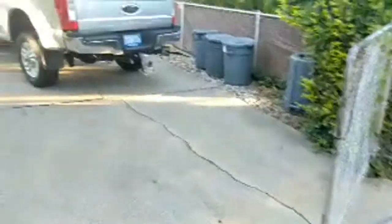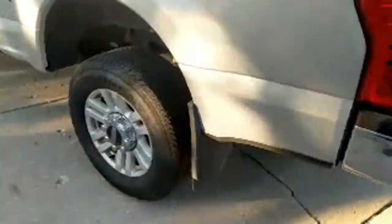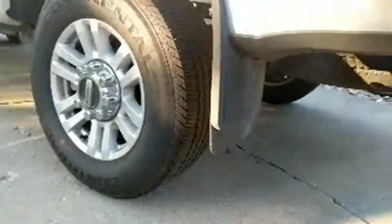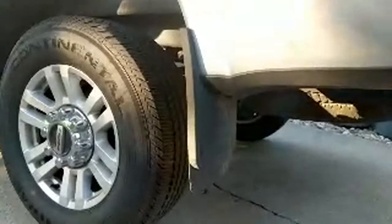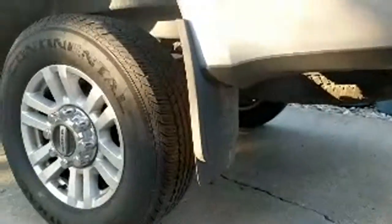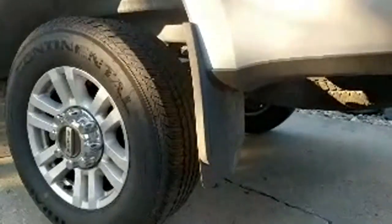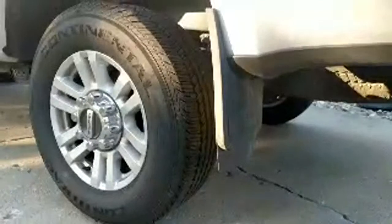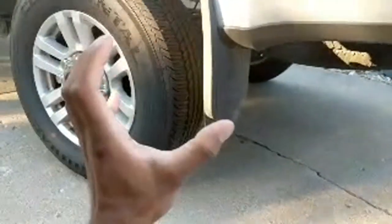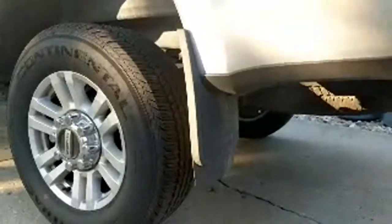Now, looking at the full floating rear end, it's extremely rare for a pickup truck to break an axle. I've seen semi trucks in really heavy duty use, like gravel haulers carrying, I'm going to say, 40,000 to 50,000 pound loads of hard fill rock, break axles that are this thick, heavy duty axles. They're full floating rear ends, obviously.